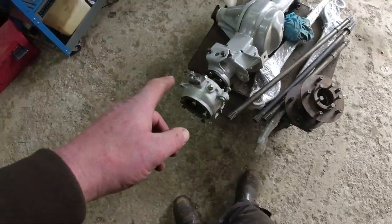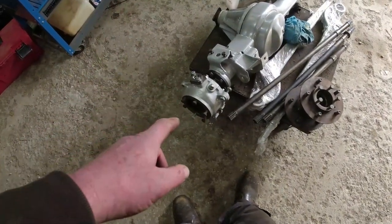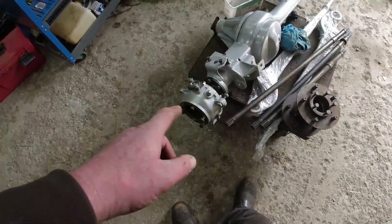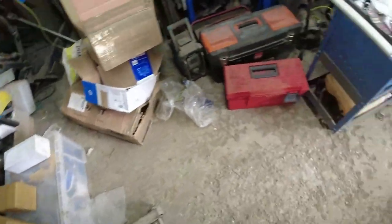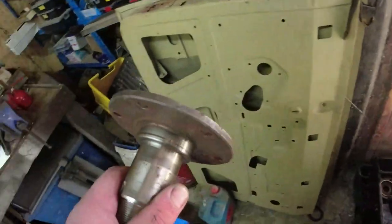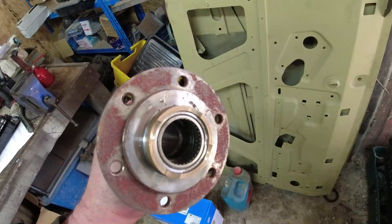It's got the ABS. I'll put new pins, new swivels, new cup, new bearing on the swivels. And I've got new CV joints, and I'm going to reuse drive shafts, and I've got new hubs. Because the hubs were — they're alright, but I've seen better. And then on the back side of them, they've just been mullered.